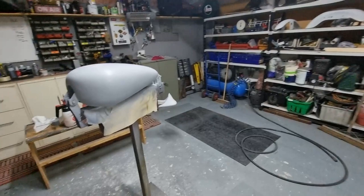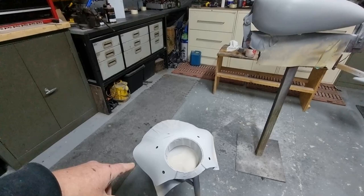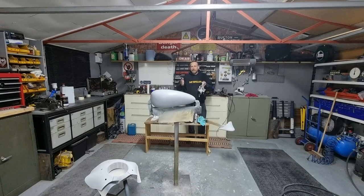We're not too worried about the fenders — you can see them on the shelf over there — and we've got the side panels to do as well. The main thing is I want to get the base coats here so we can lay the pattern, and that's going to establish what's going to happen with this and flow through to the fenders. With this gun we'll be using around 26 PSI — that's all you need. With quite a wide fan, you want a nice even coat, especially with it being a metallic. So 26 to 28 PSI, no higher than that.